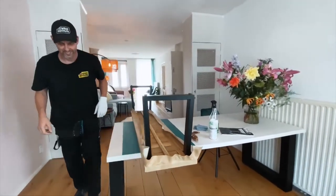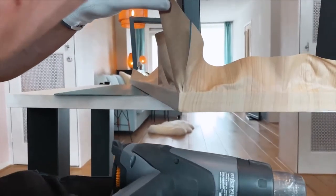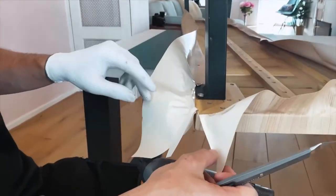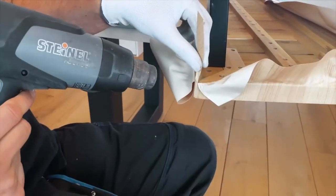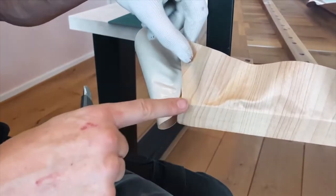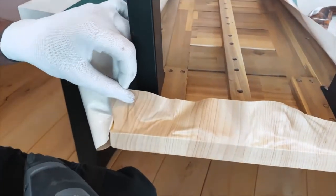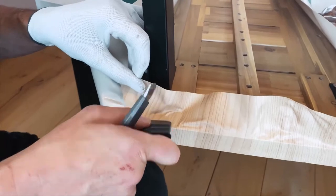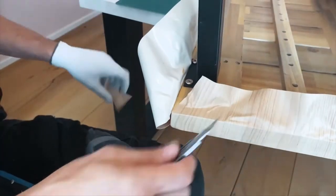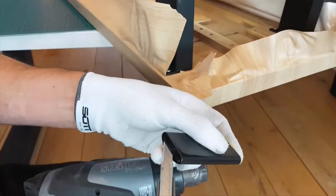Now get the material prepped for the other side — place it in an area that's easy to access. Cut the corner out in a special way: make two cuts, separating it into three sections. Heat the middle piece and stretch it gently toward the middle. With one side, heat it, form it, and once it lays flat on that middle piece, trim a little of the excess film right on the edge. Repeat the same steps for the other side — heat, stretch, flip over, then trim.